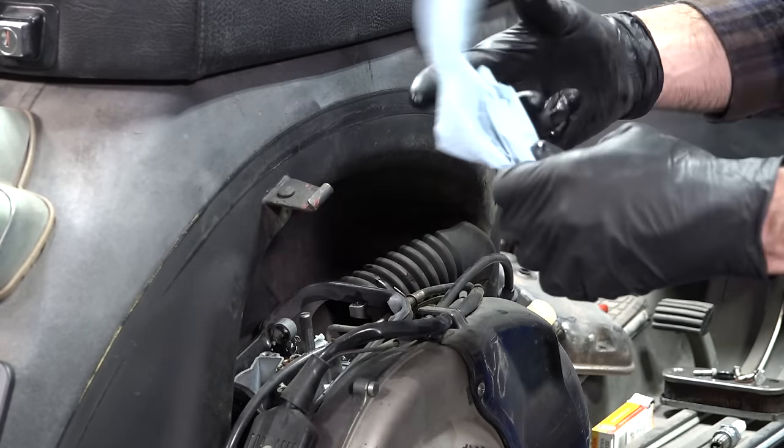The tires look to be in pretty good shape — just a little bit low. They're fairly new Pirelli Angels on tubeless rims. I can tell the rear is definitely low before I go on a test ride. Anytime I check out a vintage bike, I wobble the rear to make sure the rim's not loose — you may want to pop the cap off and make sure the cotter pin is in place locking the nut. I'd say 28 PSI is appropriate for the rear. A pump like this stops when it's at the set pressure — you can buy one on ScooterWest, tool-dash-air. For the front tire, maybe 20 PSI is appropriate, going as low as 18.